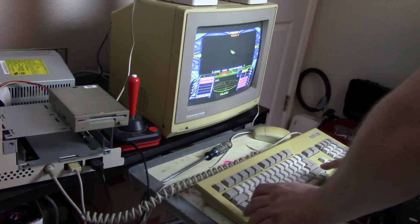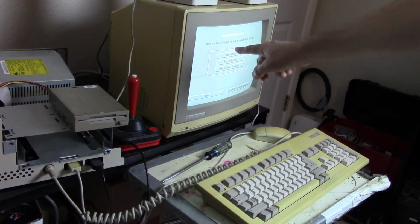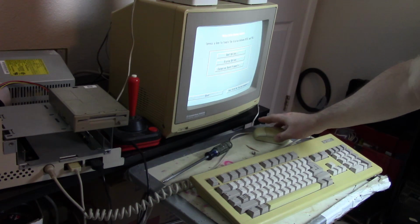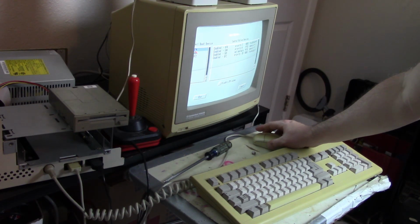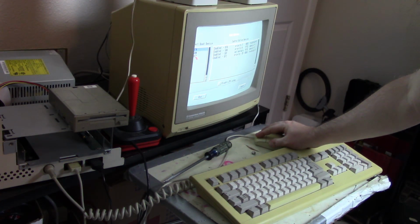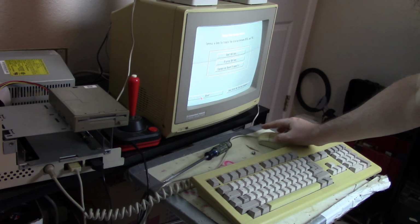So first I'll just try, and then I'll hold these. See if it does anything. Okay, look, we get an Amiga early startup control. Again, sorry this is at a weird angle, there's stuff behind me. I haven't finished cleaning up this room yet. So I have boot options. Oh, I can select things, like select boot device, DF2. And I think that's the problem, because for that selector to work, I think we want DF2 to actually be DF1. I don't know. Let's try this.